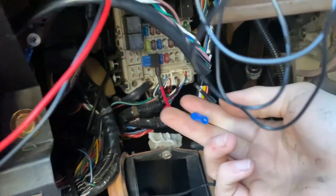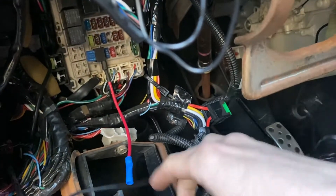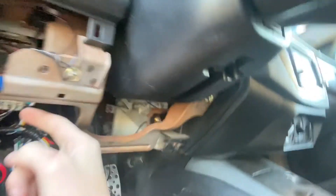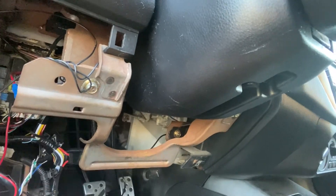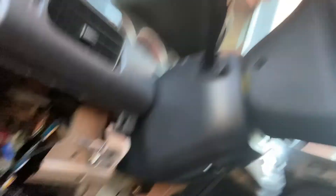Alright, so I got a 12-volt that only comes on with the ignition, and I need to find a constant — I'm going to use the 10-amp fuse right there and wire those in so these gauges have memory. Let me show you guys: I have the fuses in, and they're run down so I just need to connect the wires that go up and over to the gauges to the 12-volt power, then run a constant to the other gauges so they can have memory. That one's my constant. Pretty simple stuff.